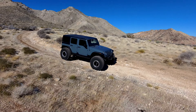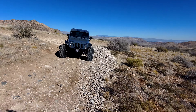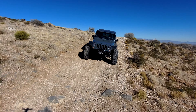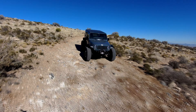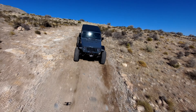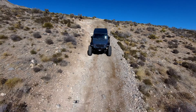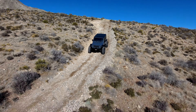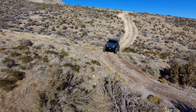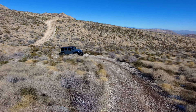The cost of programming these has now come down — it's not cheap, not as cheap as an LS, but it's come way down. So you're going to be seeing those L84s and L87s. Go drive an L84 5.3 in a rental truck — you'll be amazed how much power it has. That thing will outrun a Hemi 5.7 pretty much with ease, same thing with a 6-liter LS, and the whole time getting 20 miles to the gallon. The L84 and L87 also introduced stop-start, which a lot of you don't like — I don't personally like it. When the engine dies at a stoplight, that's always a trigger for me. I don't think it gains you enough economy unless you're sitting in freeway traffic for 10 to 20 minutes at a time. But other than that, I prefer not to have stop-start.